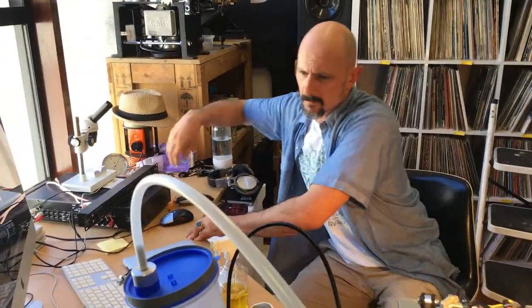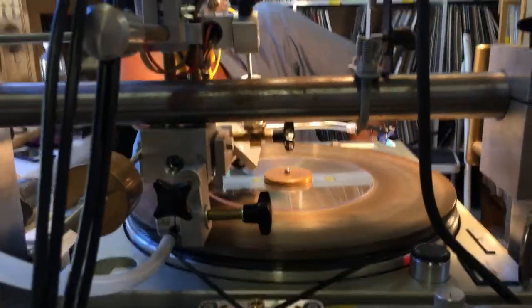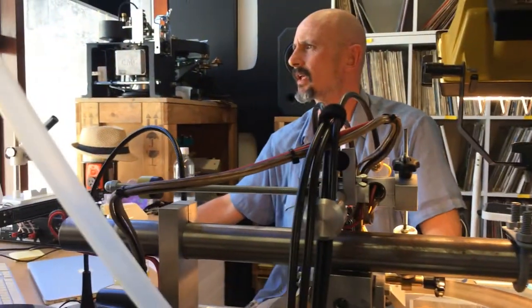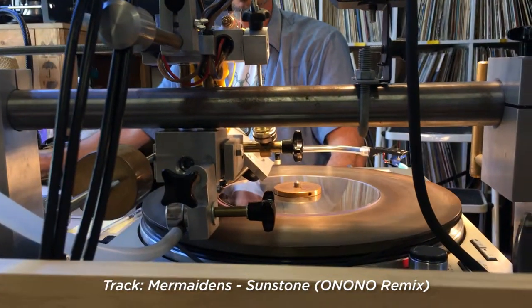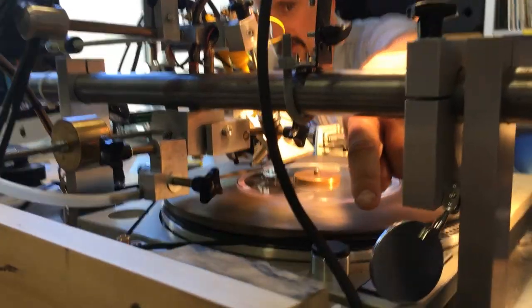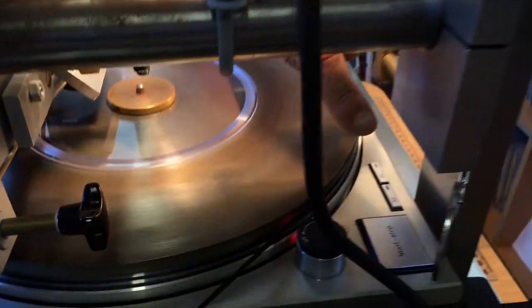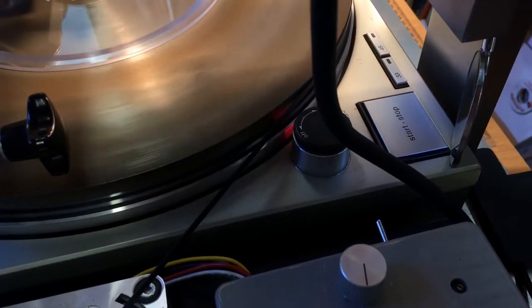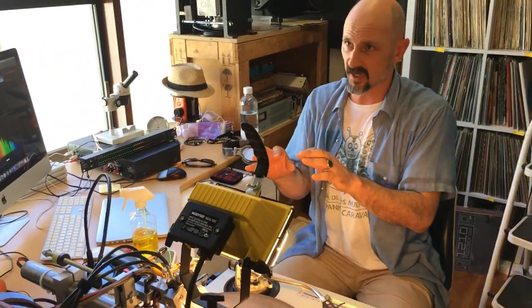Turn on the vacuum — needle's cutting. Turn the temperature on, slow it down, and press play. Can you look where the red light is? You can see the strobe, and the strobe should be steady. There should be some circles there you can see flapping around, and that indicates movement — it's unstable — which means it's recording the sound, and it'll be moving the sound, so the sound will be going through.